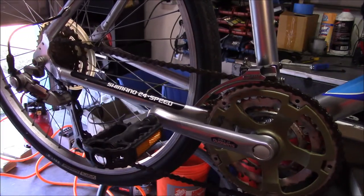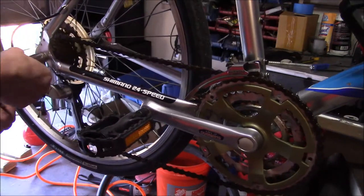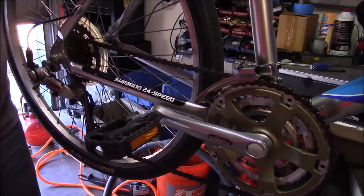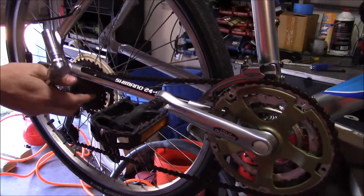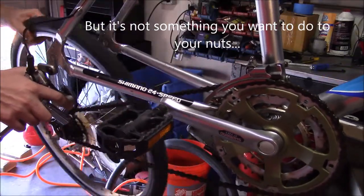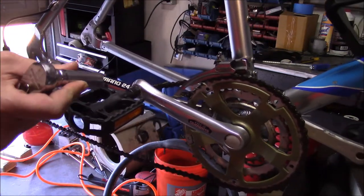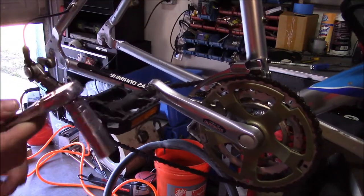This bolt happens to be a 15mm. That's another tip: don't use standard tools on metric stuff. If you have a metric nut or a metric bolt, use metric tools. Don't use standard tools and vice versa. Just because you have a bicycle and a random box of tools does not mean you have the correct tools to work on it. Go to Harbor Freight and buy a $3 wrench set if you don't have the right ones — or a socket set or whatever. This happens to be a really nice Gear Wrench 84-tooth ratchet. That's what I use for my motorcycle mechanic stuff. It's insanely precise and I absolutely love this thing.